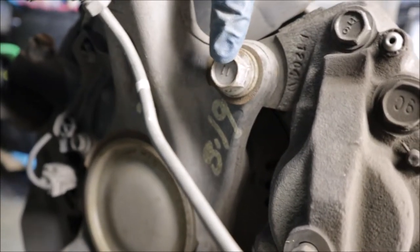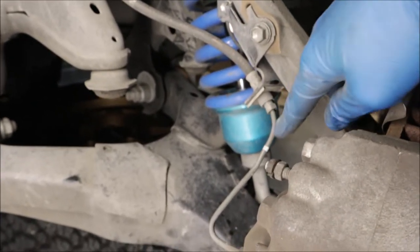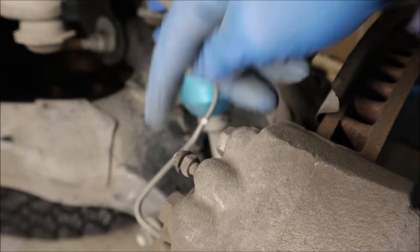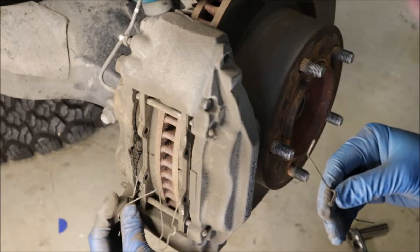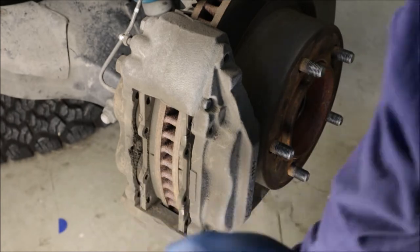On the back here you can see where the bolts are for the caliper — one on top, one on the bottom — and that will undo the entire caliper so we can get the rotor off. Before undoing the caliper, there's a hard line that comes out of the caliper and into the spindle, then up to the brake soft lines — I'm going to undo this 12mm bracket so it comes loose. You don't want to be prying on the caliper with that hard line going into it because you'll just bend it. There are actually two retaining clips — one on the bottom and one on the back that slides in and holds the pins in place. Once both are removed, the pins slide out — if you're lucky enough not to live in a corrosive environment. You might have to compress the pistons a little bit with a screwdriver or special tool to open them up.